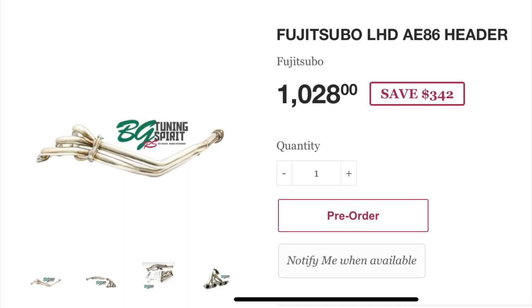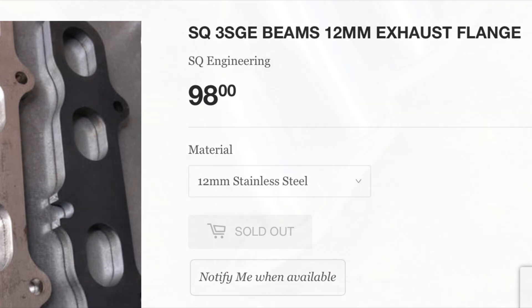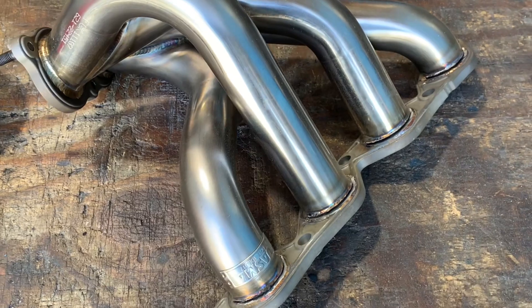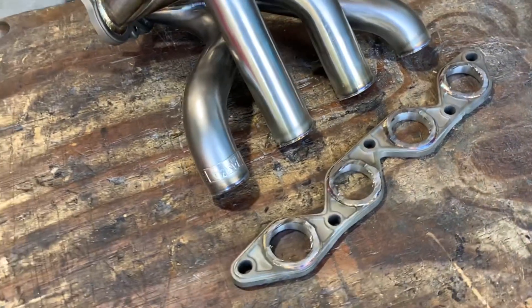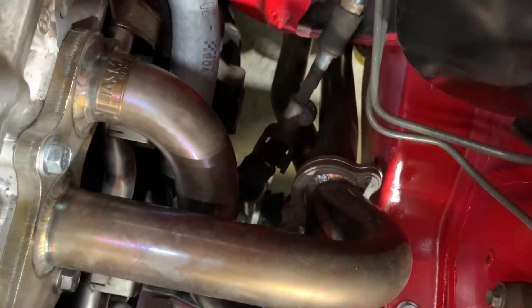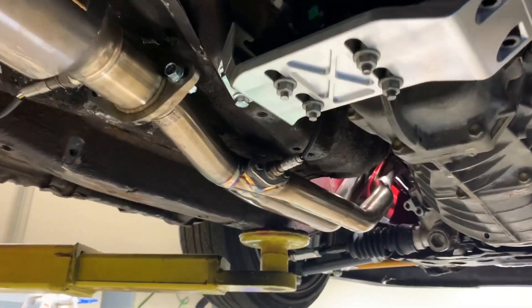The header is one of the most complicated parts of this engine swap, so we decided to take an existing AE86 header and modify it to work on the BEAMS engine. This is something most competent fabrication shops can do, but it's very important that they adjust carefully when mounting the header to the BEAMS flange — if not done correctly, the header might hit the floor of the car and not align with the exhaust system. Here's the completed header after welding and fitting. Because it was designed for an AE86, it has proper clearance around the steering shaft and the frame rail, and aligns correctly underneath the car to the exhaust system.